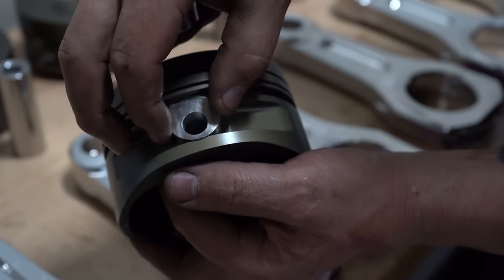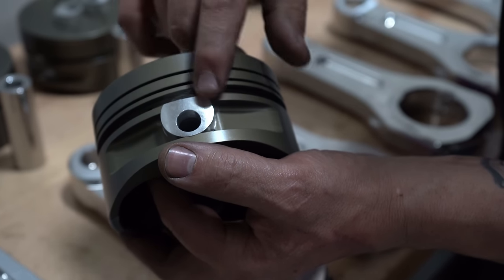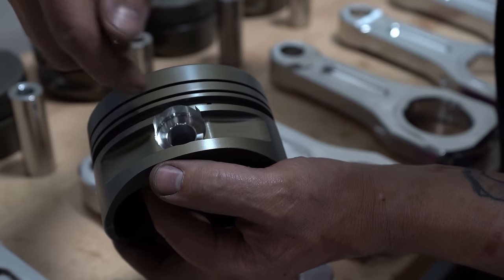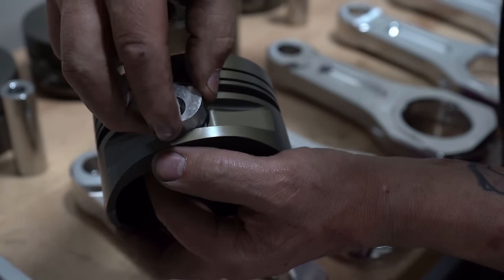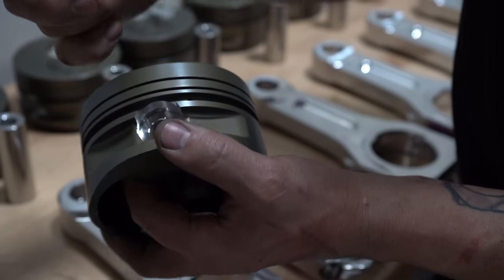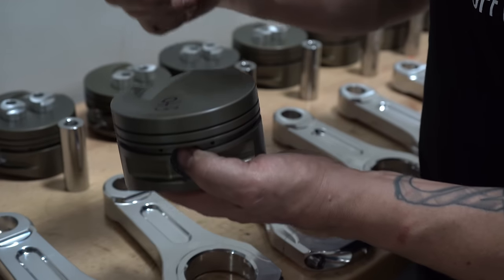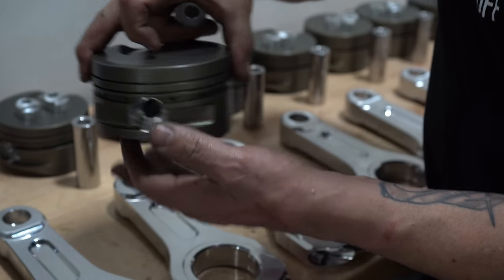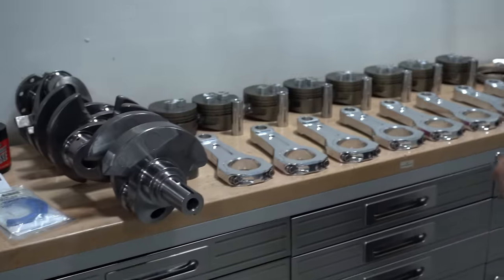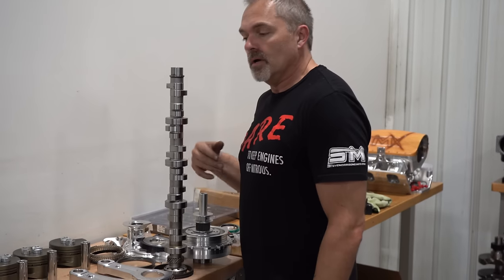It fills that hole. If you want to see me talk about this a little bit more, you can go to one of my Steve Tech videos or any of the piston videos. But this supports the oil rail because the piston pin is all the way up here. Instead of having locks in there, because the locks may start coming out, especially if you miss the tune-up on it, they will come out. Guarantee, if you miss the tune-up on these things, they'll come out. And sometimes I think they just come out because they make too much horsepower. So we have buttons, MGP rods, obviously the billet crankshaft. I'll talk about the camshaft and some of the other stuff as we go along.